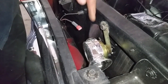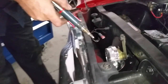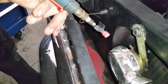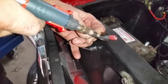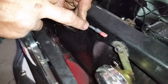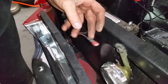And then after we're done there, we'll run one lead from the other terminal on each horn, ground it, and it will be done — and you'll have horns. So here we're going to go ahead and shrink-wrap this. Even though these are completely insulated type terminal connectors, I like to shrink-wrap around here so it's completely covered and protected, just like that. These even have built-in silicone inside so when you heat it up, it oozes out and seals both ends. That's the best kind of shrink-wrap you can get. This way there's no water or anything that will penetrate in there and get to the wires.